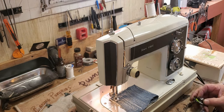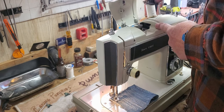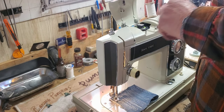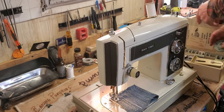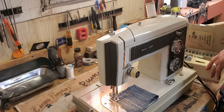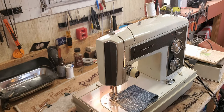Let's go back to the permanent cam. Open the door, push the cam follower back, take this cam out, and I'm going to put it with the white side facing the guide pin. Without this cam in here it's not going to zigzag — you could sew a straight stitch without it, but just leave it in all the time when you don't have one of your other cams in. Your buttonholer and various other assorted goodies are in this box here. And online you can find bigger sets of cams, lots of different buttonhole patterns, and different accessories you can add to this machine.